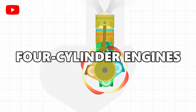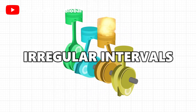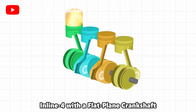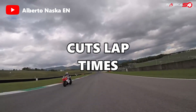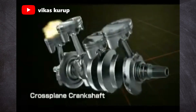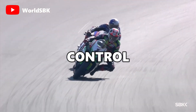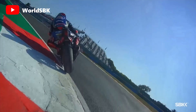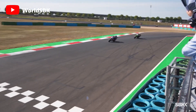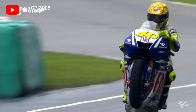Unexpectedly, four-cylinder engines with a cross-plane crankshaft produce firing orders that are spaced widely apart and at irregular intervals, which is the opposite of flat-plane crankshaft motorcycles. This improves motorcycle responsiveness and cuts lap times. This firing order gives the tire more time to move freely, improving control and increasing the sense of the traction limit, particularly at corners — meaning you can get to full throttle sooner. Even MotoGP champion Valentino Rossi admitted that the rideability of cross-plane crankshaft motorcycles made it one of his favorites.